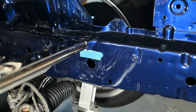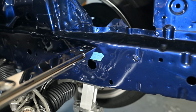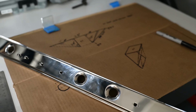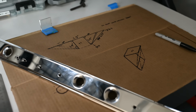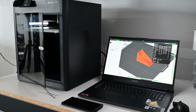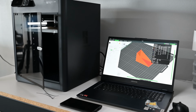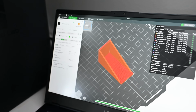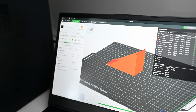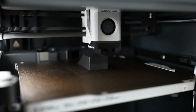And this is where the cross member typically mounts if there was a bracket there. I had a friend in a RX-7 group chat get me the distance that the bracket mounts from the top of the frame rail, so I can get the proper height of the cross member once it's installed. You can see here real quick the bracket that I made. It's super simple, and I ended up cutting it out of aluminum box tubing.